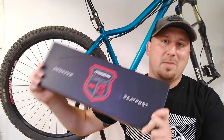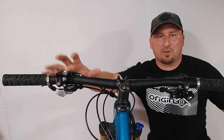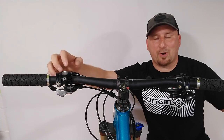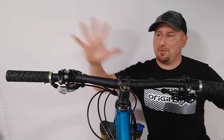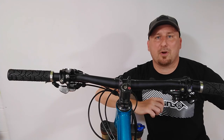We're also going to be focusing on the Manitou Jack dropper post, installing it and modifying the frame a little because this is an internally stealth-routed only dropper post, and this is a classic frame that does not have any provisions for that. One of the things we're looking to do with changing up the drivetrain from a 2x10 into the Advent X 1x10 is cleaning up the left-hand controls. On this side we have the brake, a shifter, and an existing dropper post cable — three cables with a lot of slack. So we're going to free that up, get rid of the front shifter, so your left hand works the dropper post and your right hand takes care of all the shifting duties.